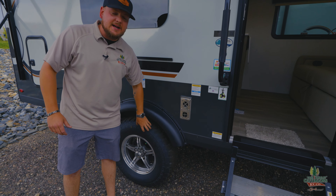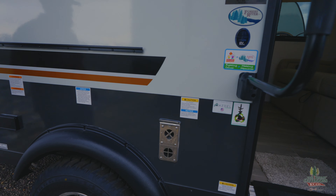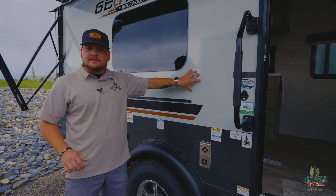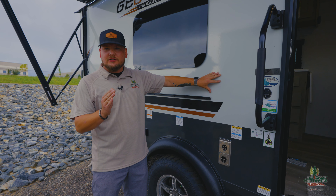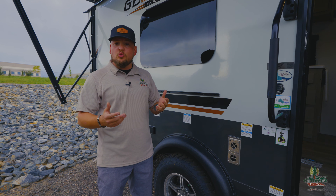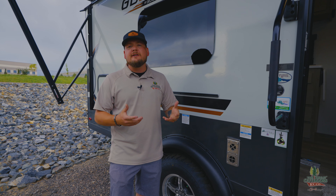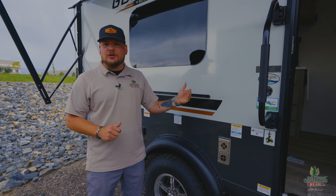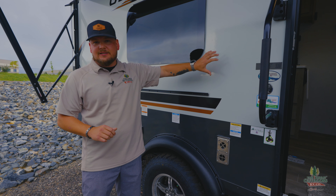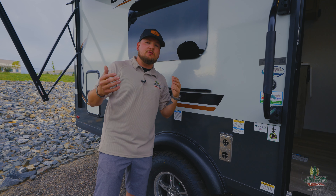The tires and axles are unbelievable, but the way they construct this coach is a little different from most stuff at this price point — they make it lighter weight and less susceptible to mold and mildew damage. They use fiberglass, a composite material called Azdel, then block foam insulation, more Azdel, then wallpaper. Normally at this price point you'd have luan in place of the Azdel, so it's fiberglass, luan, block foam, luan, and more wallpaper. The problem with luan is if water seeps down the sidewalls, it's totally ruined. With Azdel, it's completely resistant to mold, mildew, and delamination — and it's lighter because plastic is lighter than wood.